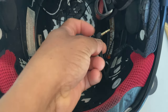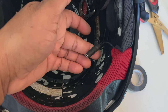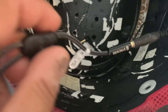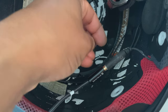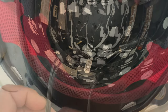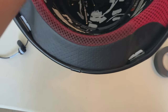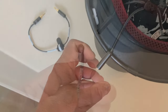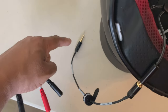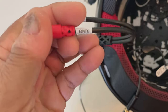Typically the speakers are plugged into the comm unit right here, but instead what you want to do is first connect the new splitter back into the female of the comms unit. With that done, take the headphones — or the speakers — and plug them into one of the females of the splitter that you just installed. With that done, you should have one female port remaining, and that's where the attenuator cable will be plugged in using the line level end. Then you've got a free end of the attenuator cable, and you're going to plug that into the red side of the breakout cable, which is ring.